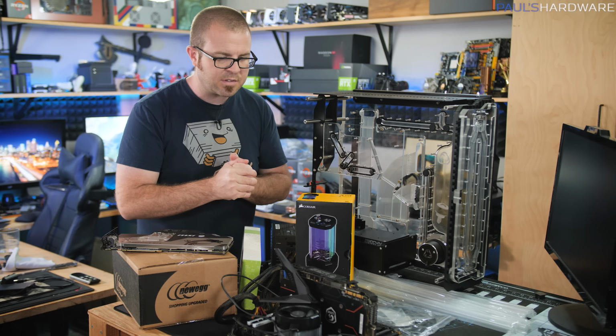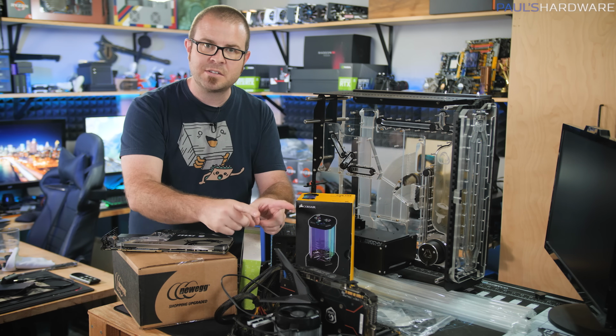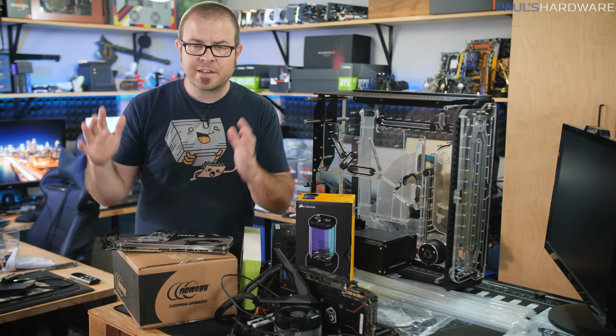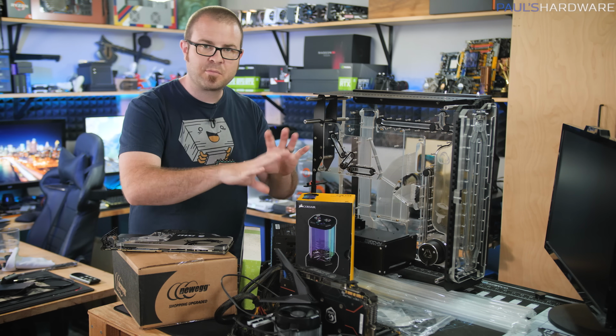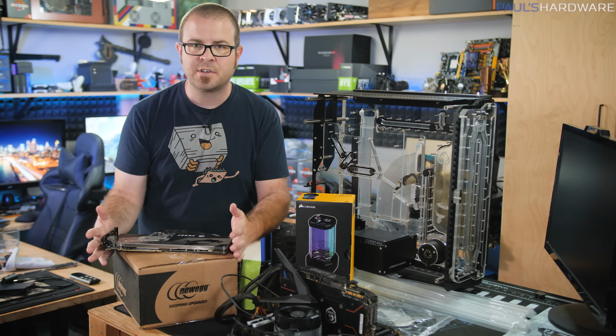the operating system installed. And what that means is that once I've double checked that the motherboard's gonna work with a BIOS update, and I haven't done the BIOS update yet, I can install these graphics cards, set up an impromptu open loop just to run some liquid through the cards, and test the cards themselves as well.